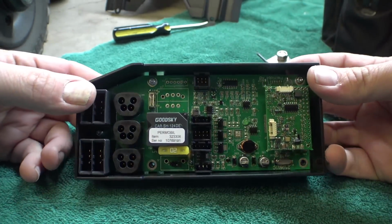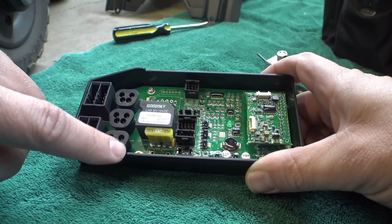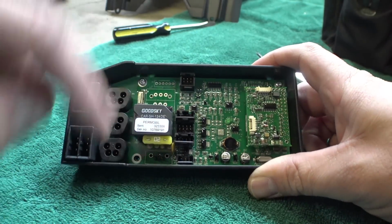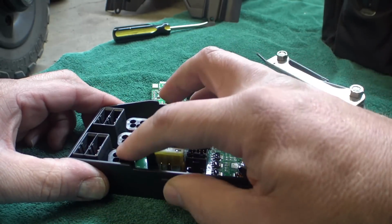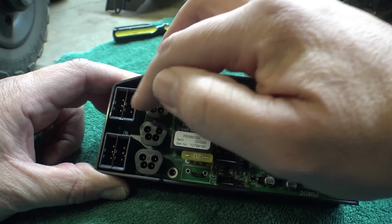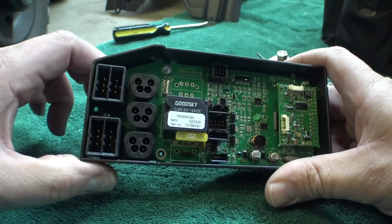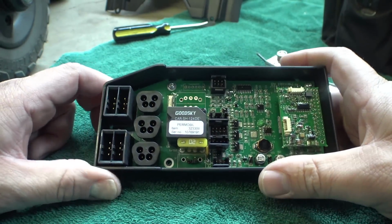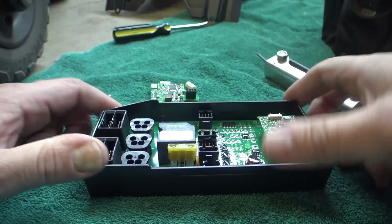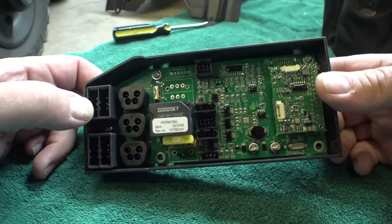Yeah, it's interesting to see the evolution of things. The original old school ICS modules, the board ended right here. And these connectors were stacked in here. You can see the old positions where they used to be. And instead of having actual RNet connectors, they used the 4 of these, and they had an RNet to 3-pin ICS bus cable adapter that they used. But in later versions, they added on this little wing with extra connectors down here, which saves a little bit of wiring, and the cables are connected better. They're not going to come apart. The more connection points you have, obviously, the more points you have for problems or things not working correctly.